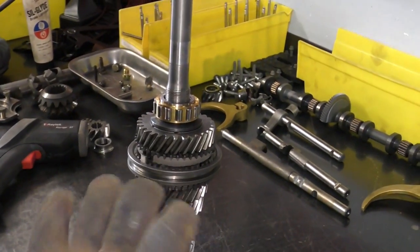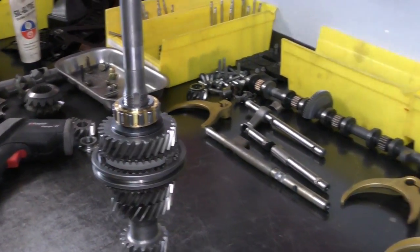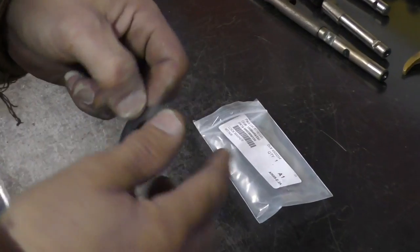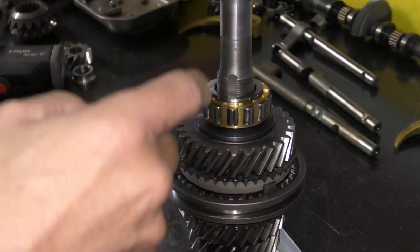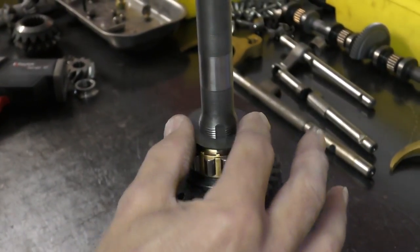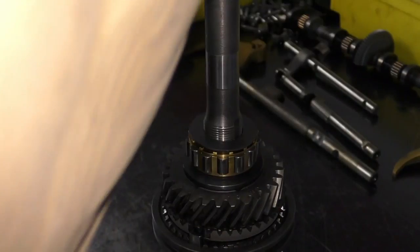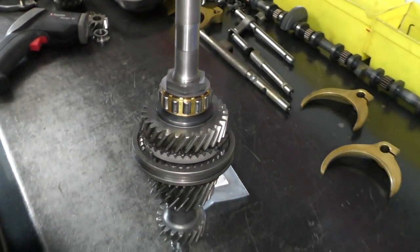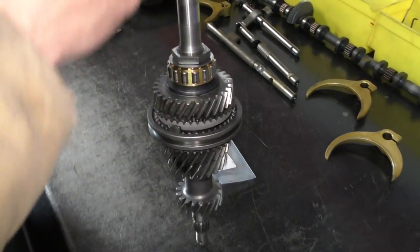It's on all the way down. I've got my cage facing my clutch disc, so now we're just ready for our new lock washer and our nut to tighten everything up. The lock washer has a little tab that locates on our shaft — we want to let that tab go down inside the bearing as we slide it over. Once the tab is located we can use our nut to bring it down. Now we're ready to torque this entire assembly together, and after that we're going to put it in our v-blocks and check our run-out on our input shaft.